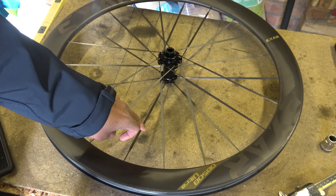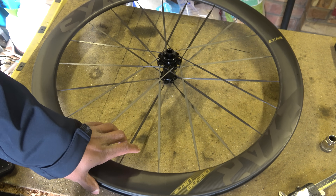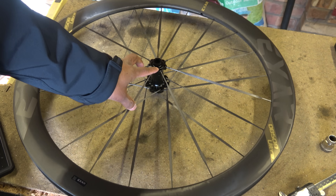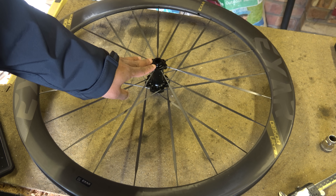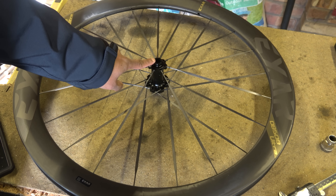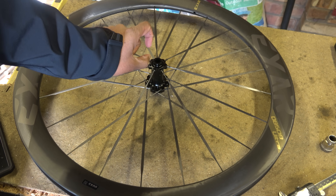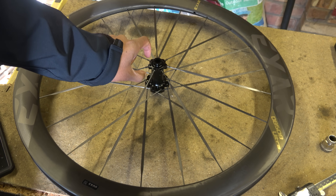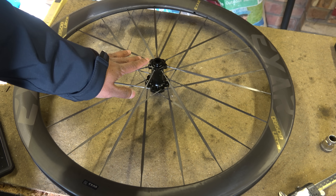The far side — the drive side — is completely radially laced. They have moved the position where the spokes engage as far out as they can. There's probably only about 9mm between there and the hook of the spoke. So that bending moment or load is moved as far over as possible, which basically makes the wheel very, very stiff.